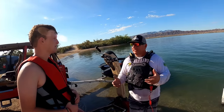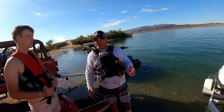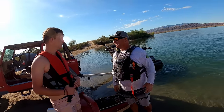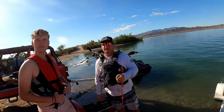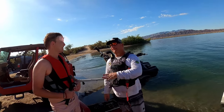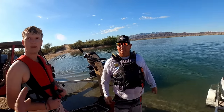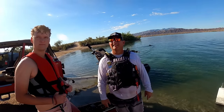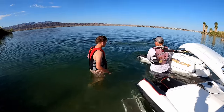It's got all the modernizations. It's still a piston port. There's still no reeds, but it has a lighter weight drive shaft. The changes through the generations have been efficient for many years. And it's been through Jetski Jimmy's full mod. Wow. But it's still stock. It's modernized, not modified. So it's all stock, but everything's all done. The intake tract and the intake, all the little tricks that are wrong from the factory. Okay. You know what you're doing.